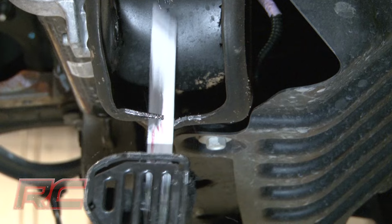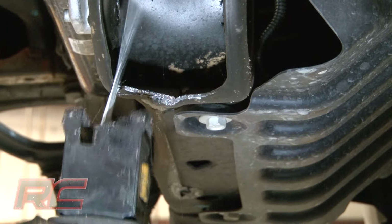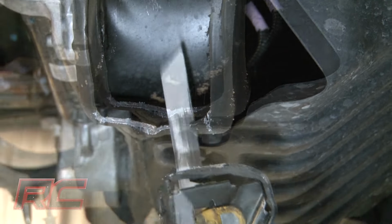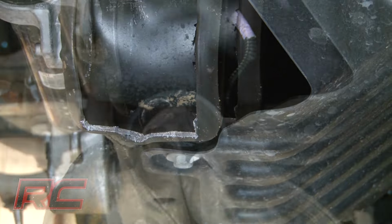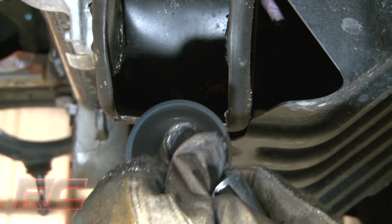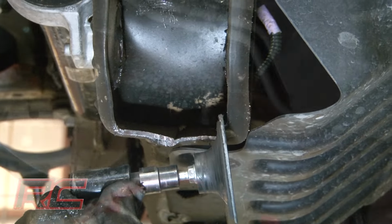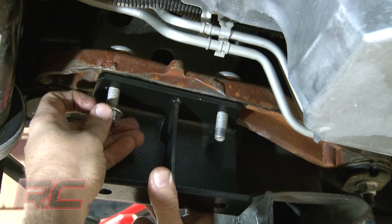Trim the lower control arm mount on the frame as shown. Trim only enough to allow for the installation of the new Rough Country crossmember. Then clean up the area with a disc sander. Install both the driver and passenger side differential drop brackets.